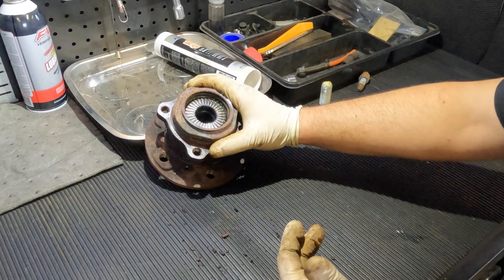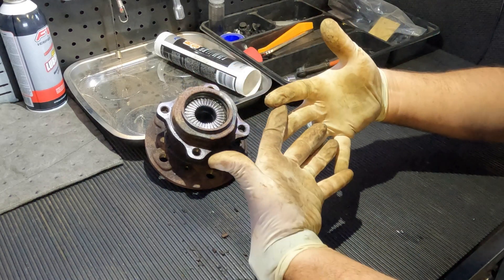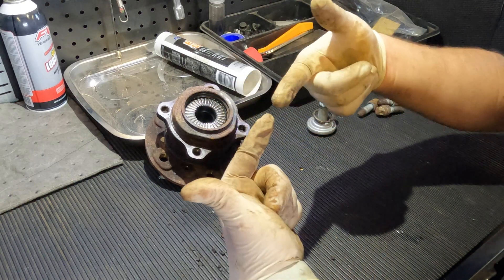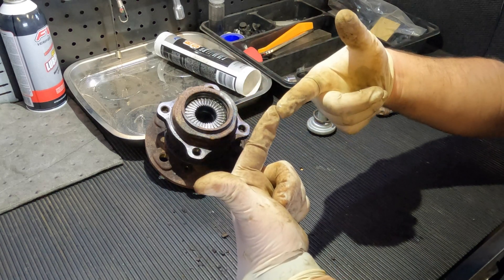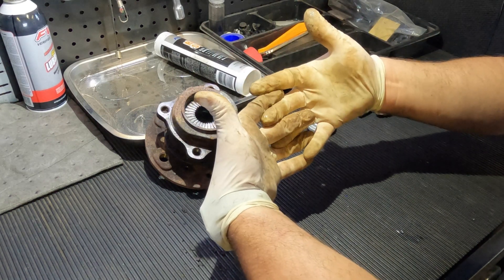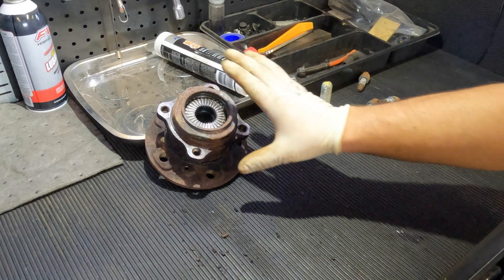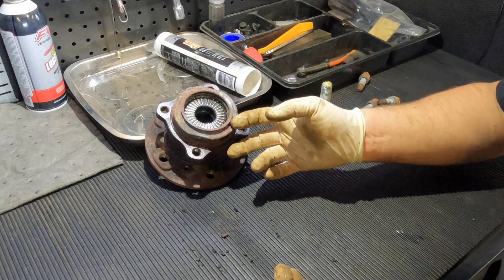The most difficult part about installing this is making sure the splines are nice and intertwined, because you can actually put it where it's like two gears on top of each other. If you put gear to gear and try to drive it, you're going to shear it off. You've got to make sure they're intertwined and coupled together so they form a nice unity. It's a little bit more nerve-wracking, especially if you're doing this at home, versus an axle with a stub shaft and splines where you just put it in there and tie it up.